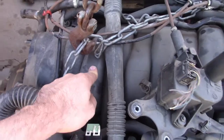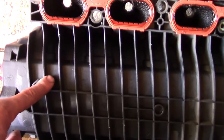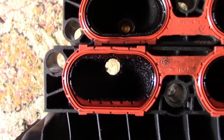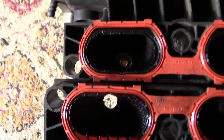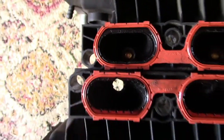Here's the vanos and here's the non-vanos — you can see the non-vanos port is slightly bigger. The edge on the vanos one is plastic, and the non-vanos is not, so it has a slightly bigger runner.